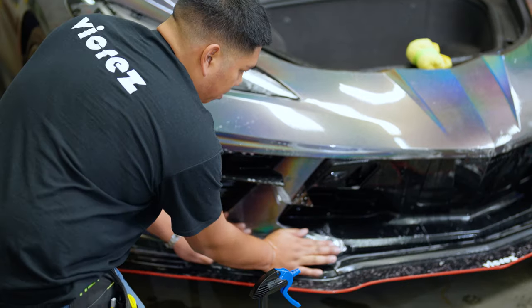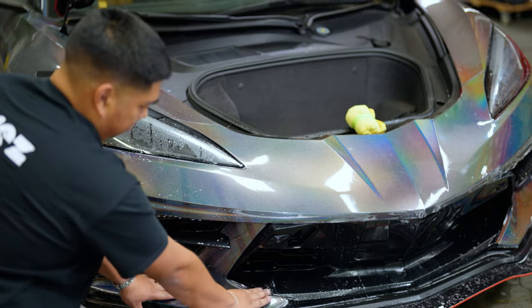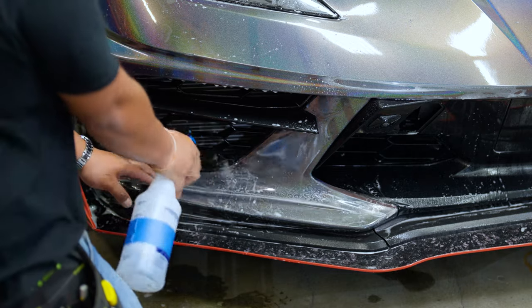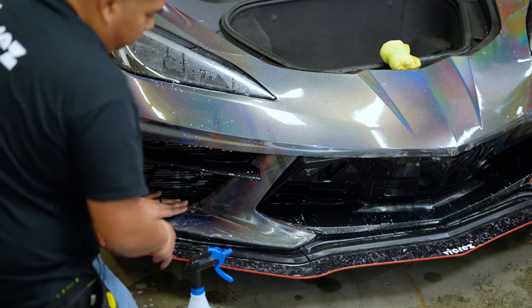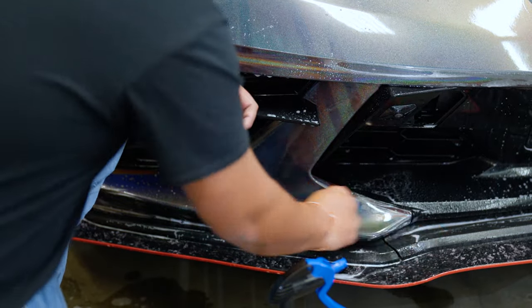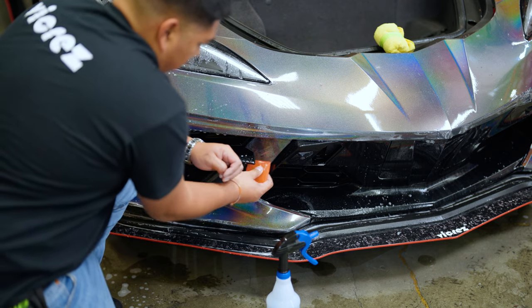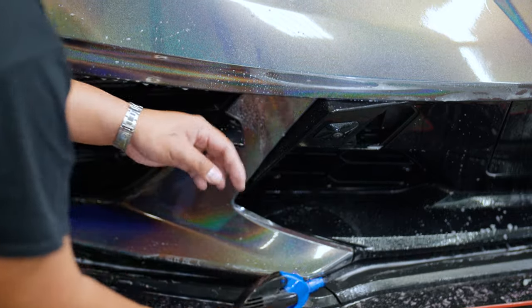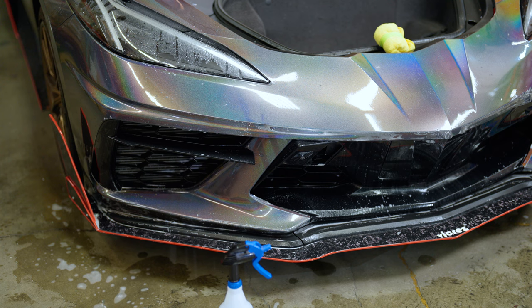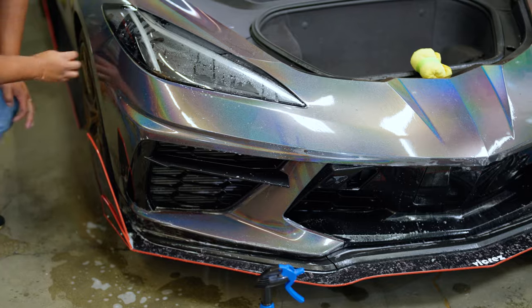Spray your tack, we're going to stretch — that's tacked. Now we don't have to worry about the top, which is good. So we've got all that lined up now. And we just spray our tack solution down here, hold it for a couple seconds, start squeegeeing your tack solution down here. Tack solution, line it up, squeegee. So you've pretty much got all of your water squeegeed out. If you see any excess water, go over it again with your squeegee.